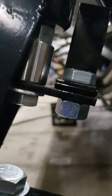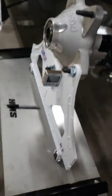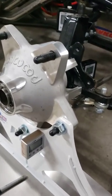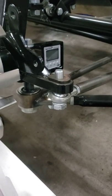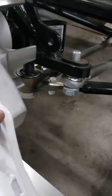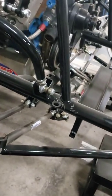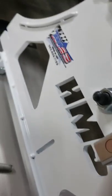When we get into doing our dirt late models or pavement late models, I've got an L bracket. I'll try to turn the phone around so you can see — what that does is simply move the caster gauge out and around the body bracing. If you've got stock spindles without any braces welded on, you will not need that. That one down there was one we were using for pin inclination — there's another video on just that. Another thing I like to do: get a reference point from here to the chassis, front and back. That way I know my wheel is square and I can start setting my toe off of the chassis, then use our toe hooks down here, front and back, to verify.